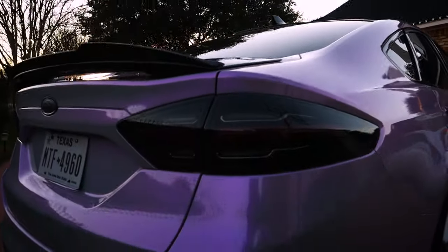I also have a set of Porsche style tail lights. I absolutely love these — they give the rear end a really modern look and pair really well with the rest of the black accents on the vehicle. The number one question I get is about fitment. Will they fit newer Fusions? Short answer: yes. Long answer: you need to do two things. One is a trim piece, because newer Fusions have little chrome trim pieces incorporated into the taillights that the 2013–2016 Fusion doesn't have. You need to source this piece — it's super easy to find online for around $30. There's also a new version with an LED strip. The second thing is you'd need to downgrade your taillight wiring harness to a 2013–2016 spec. These aren't very expensive online, and you'd just take it to a shop to have them swap it out.